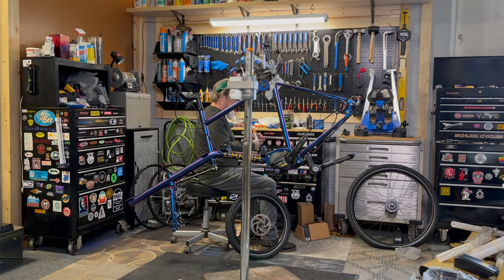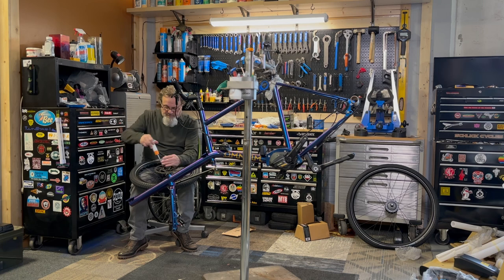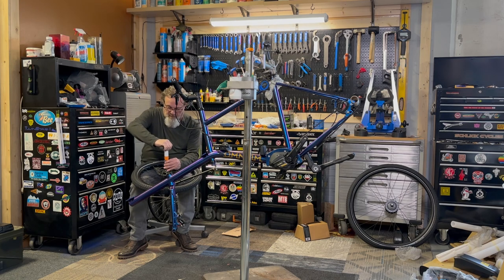And we're set at 6 already on this. This is kind of my go-to for doing torquing on rotor bolts. So it's just going to put it in. Turn it. Tighten these up a little more. Almost torqued. What happens with these torque wrenches is they click when they're right. One click. You don't have to do 50 clicks. You just do the one. And it should be torqued right there to 6 newton meters. Thusly.